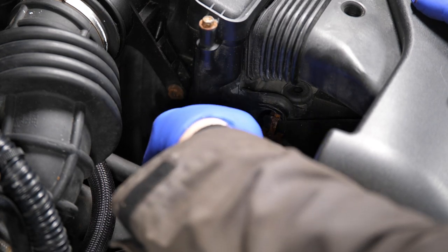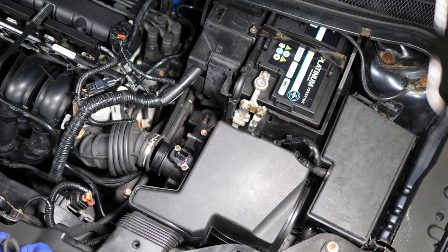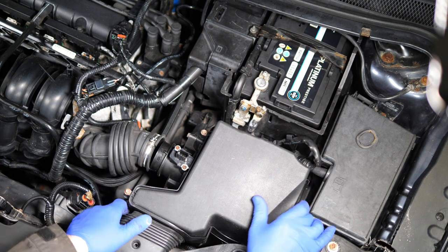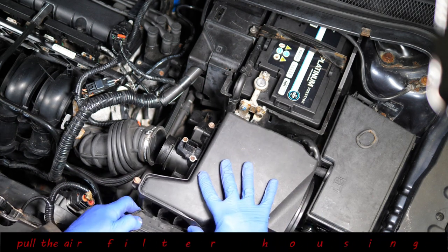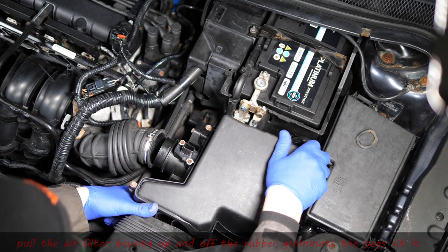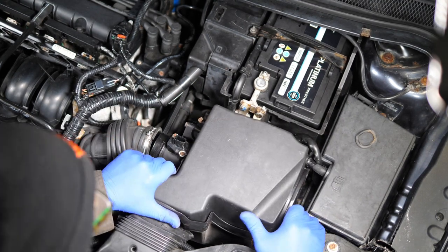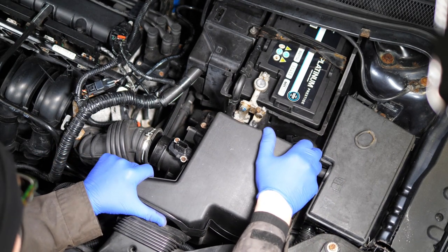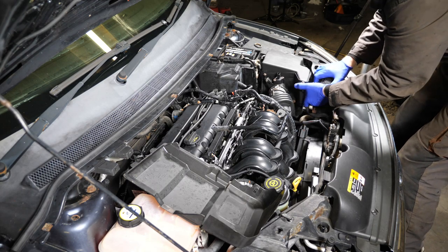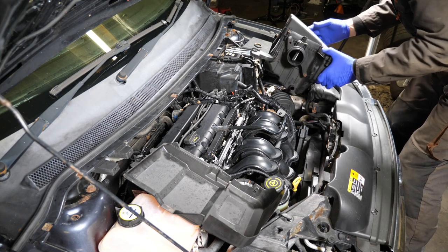There's also a little rubber retaining ring here — put that somewhere safe, not where I put it because I'm going to lose that later in the video. Then it's a case of just pulling the air filter housing up and out of the way. On this model there may be other connections on different models, but on this particular Ford Focus that's all you need to do. It should come up with a bit of wiggling — you just pull it off the studs underneath.